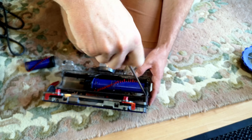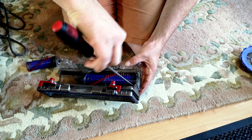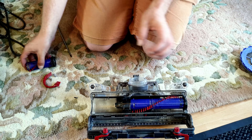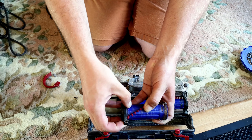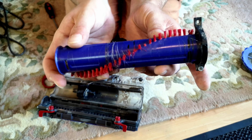Let's take the other one out just to check. On this era you need a cross-head screwdriver — it's not a pretty job. All the fluff builds up underneath that bearing cap. It's ever so funny for a machine that must have cost billions of pounds to make. All the fluff builds up under the end cap and on the case of this one, it pushes the end cap up and just snaps it as it's rolling — it just melts itself apart. So it's a fantastic design, really. And you've only just about started to be able to get pattern replacement brush rolls.